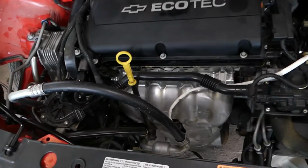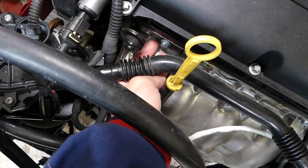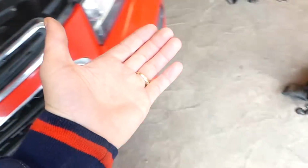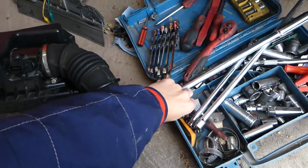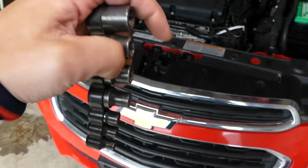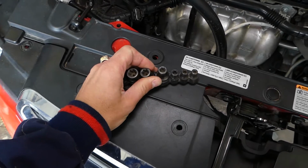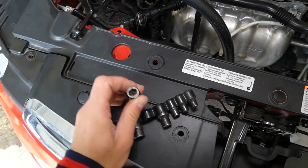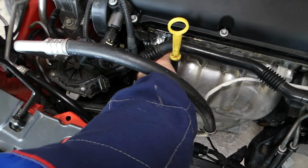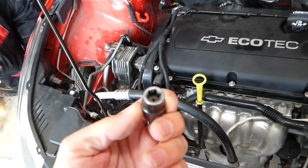Now, the dipstick, in order to remove it, you can see right here we have one bolt with reverse Torx that we need to remove. And what is a reverse Torx socket? It's this socket right here. All that will be listed in the description of the video below, all the tools and parts, for your convenience. So, let me see exactly which one it is. Okay, this is the reverse Torx 12. Yep, this is it. Reverse Torx 12 socket that we will need to use now.